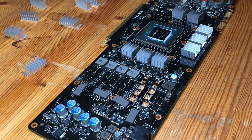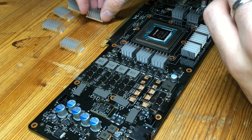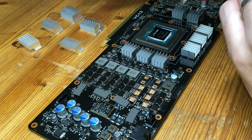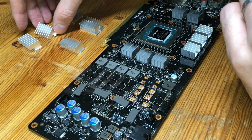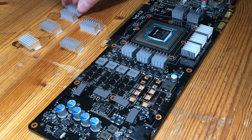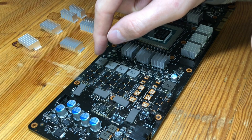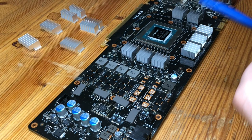Okay, so I have our heat sinks in place, and we're getting close and ready to install. To make the process as good and easy as possible, we're going to take the inversion that we did on the memory. Rather than putting the thermal adhesive onto the bottom of the heat sink, I'm going to apply a very, very tiny amount. Again, we don't want this going anywhere on the board, just a tiny, tiny amount onto the top of each node, and then firmly applying the heatsink. That way it'll bind, but also we won't have any concern about, did I hit the exact node?